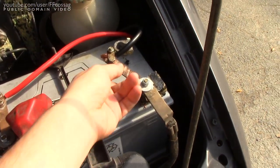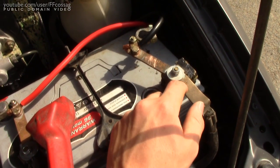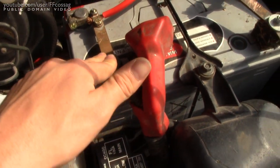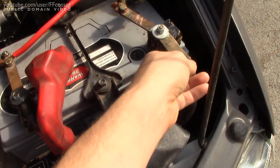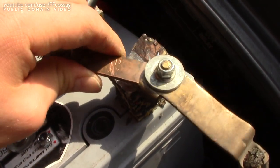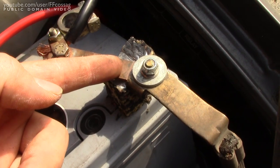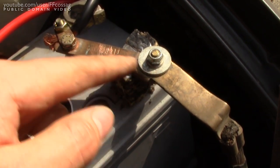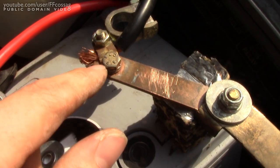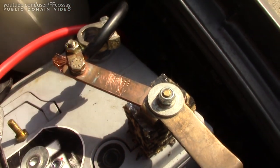While I'm out here doing stuff, I'm going to check over these battery terminals because, as you can see, they're a bit custom. I've got some dissimilar metals here which have caused a tiny bit of corrosion on the negative terminal. The positive side looks quite fine. I'm just going to clean this up in case that's what's caused the starter inhibitor issue. Just finished the negative side - it was a bit crusty under there but nothing majorly serious. These washers are supposed to be conducting because we've got this copper bar attaching to this brass strip - that's the actual connection, and it looks really clean.